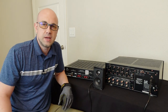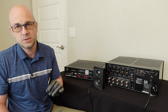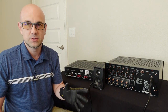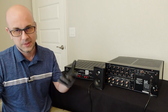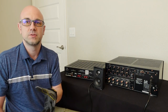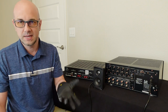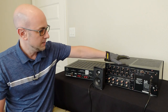Let's talk about a preamp. Maybe the route you don't want to go is a receiver — you want power that's dependable, dedicated, and stronger. So you decide to purchase a preamp. A preamp is almost like a receiver because it has the processing, all the RCA connectors, coaxials, optical digitals, HDMIs — all that stuff — but it doesn't have an actual amplifier in it, so it can't power any speakers. The reason for doing that is typically to separate things and potentially achieve better sound quality. So then you're going to need an amplifier, and you'll have to figure out how many channels the preamp supports and match it to how many amplifiers you might need.